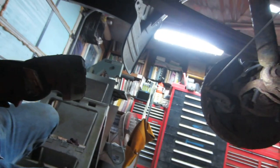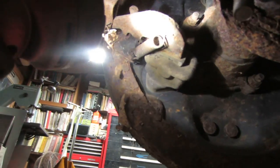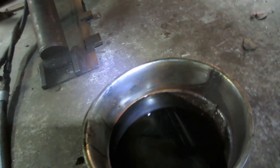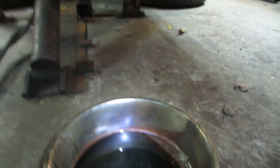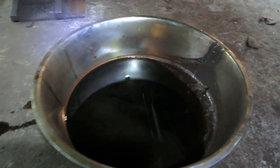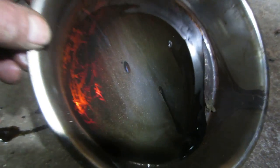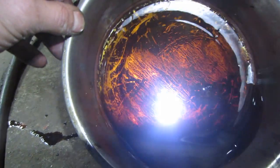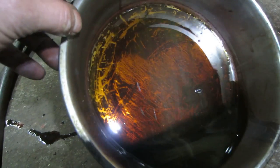We'll let that drain a little bit. I'm going to go disconnect the brake lines from the backing plates and get those four nuts off each side so I can pull the axles back. Let me get some penetrating oil on them first. Not even enough fluid to cover the bottom of the pan — that'll lead to some problems. No big clumps of metal yet though; they're probably still sitting in the bottom of it.